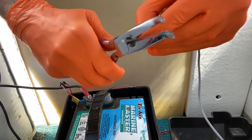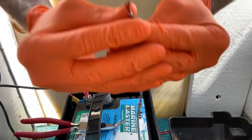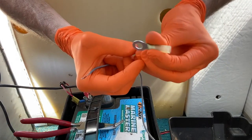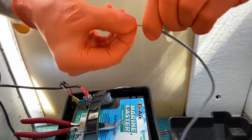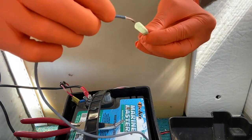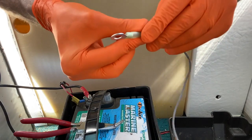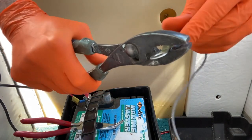About a half an inch from here, grab a new weatherproof connection point — this is a Dorman brand, and here is what it looks like. Grab all the wires and rotate them to make a point, insert the wire deep into that hole, verifying that it actually goes inside the aluminum portion. Then grab a stronger pair of pliers and crimp this portion together to lock that wiring inside the connection point.